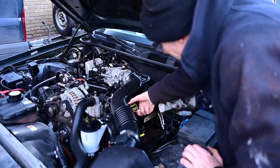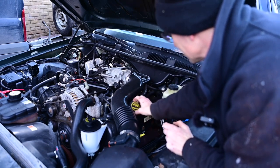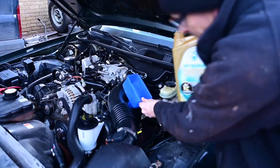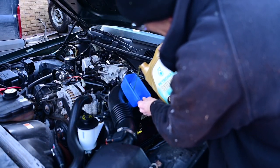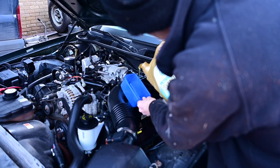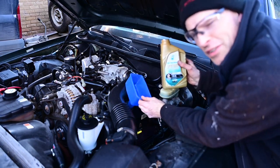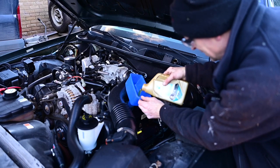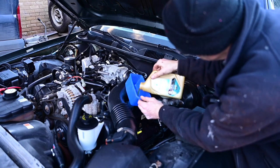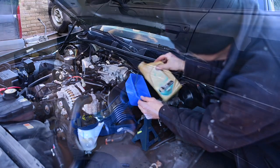As proof were needed — because people always comment about oil viscosity — it does actually say 5W20 on the oil cap. I'm going to use this pouring spout because it's so thin and so windy. I need to finish up 0.68 of this last litre — how are you supposed to measure 0.68 of a litre exactly? About that, roughly.